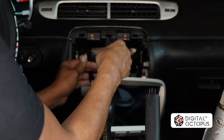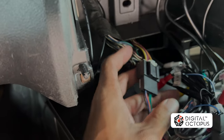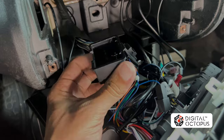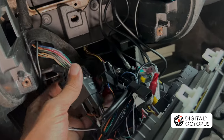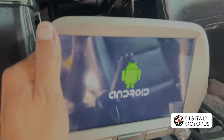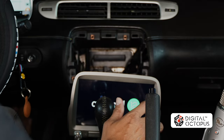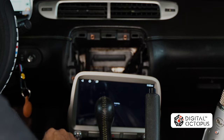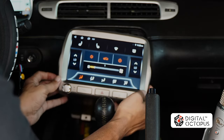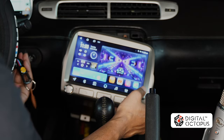I'm going to switch gears and put the car in drive so I have some space to work with. The first one I want to connect is the AC wire — leave the power for last — and that connects right into that. You should hear it click. Next we are going to connect our main harness to the main power — that will also click in. Now that that's connected you should get power on your radio. We just want to see if we have power and if everything is good, then we can connect all the little wires. It takes about 30 seconds the first time to boot up. There it is — it's running, we have our AC running, everything checks out. We're going to turn off the ignition and connect the rest of our wires.